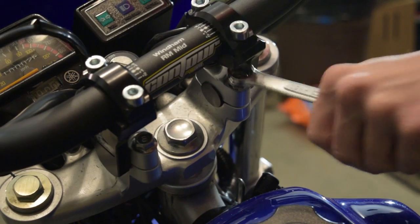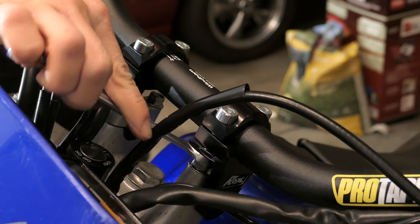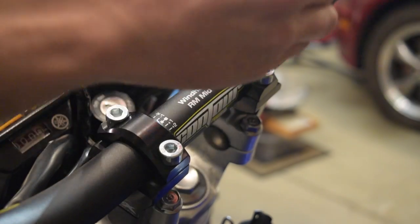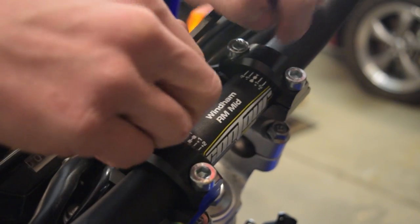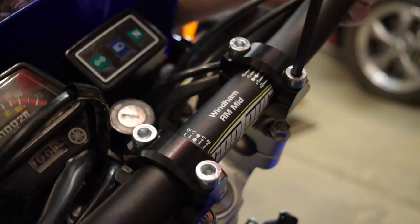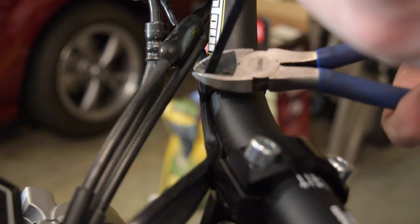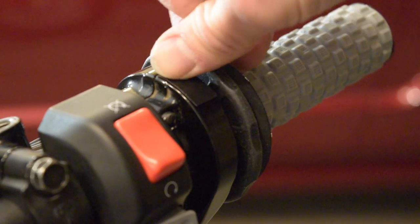I'll just have to use a regular wrench since I won't be able to get a torque wrench to fit — try to use as much force as it took to remove the bolts. The spec is only 23Nm so it's not a whole lot. Then loosen up the new handlebar clamps and position the bars to your liking, making sure they are centered and tightened down with the 6mm hex key. Make sure it is all tightened down, the risers are all the way in, and the caps are evenly spaced. Now just throw those little belts back on and some zip ties to hold the wires to the bars. Since the throttle tube is upside down, I covered the drain hole with a piece of electrical tape. Make extra sure that the cables and wires will not bind up or have any issues while turning lock to lock. And we're all done!